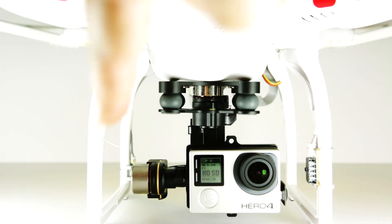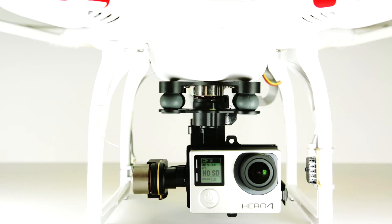There's a button on the side of the Hero that toggles the Wi-Fi trigger and the settings menu. On the Hero 4, that button is raised slightly — on the Hero 3 it's just a Wi-Fi trigger. The problem with the H3 gimbal is that a little bit of material comes in contact with that raised button on the Hero 4, causing it to depress. If the Wi-Fi turns on during flight, it will interfere with the receiver and transmitter, and it also starts toggling through the GoPro's shooting mode settings.